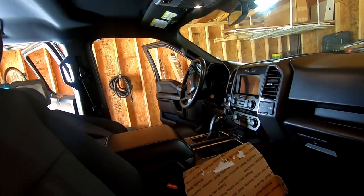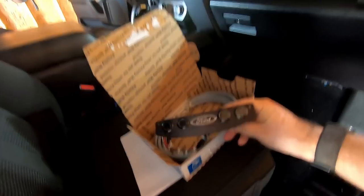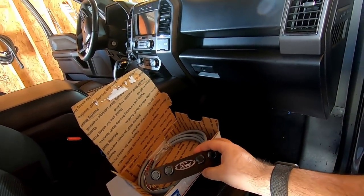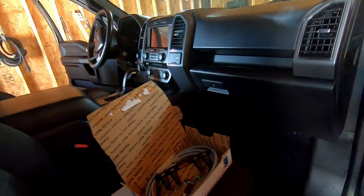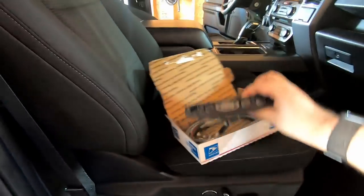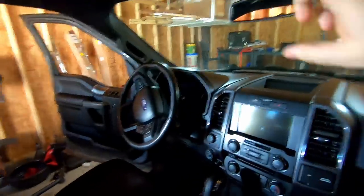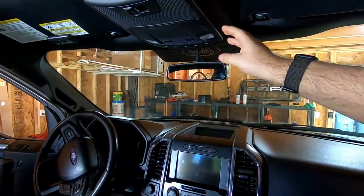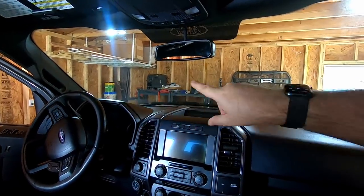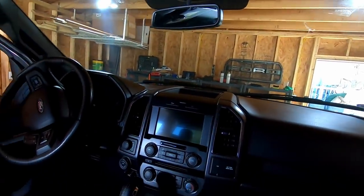So I've been looking around and I came across a guy called Custom FX — his name is Brett — and he runs a small company called Custom FX. He custom makes these switch plates, does all the wiring, and he'll laser engrave anything you want on there. It's super awesome. I've seen people that have installed it and heard great things. So I got in touch with Brett and ordered a set of these upfitter switches. This shape fits this shape right here perfectly. We need to pull this panel down, put this in place of this mesh, then run the wire down the A-pillar to where we can connect it later when we get our different things. So let's go ahead and jump into it and get this installed.